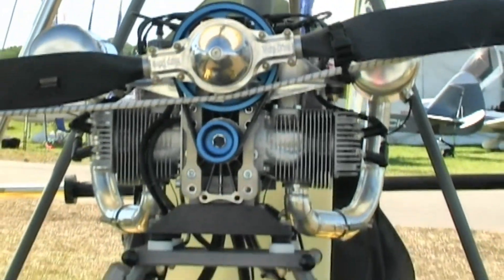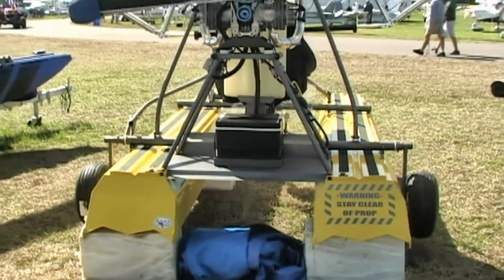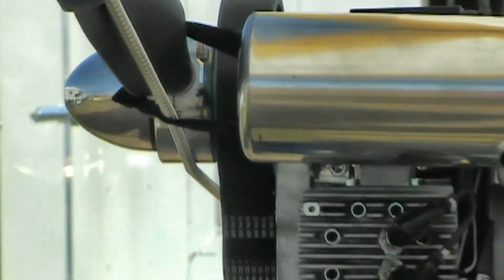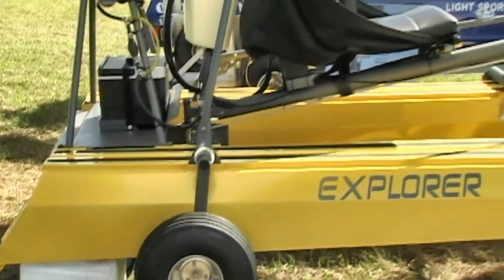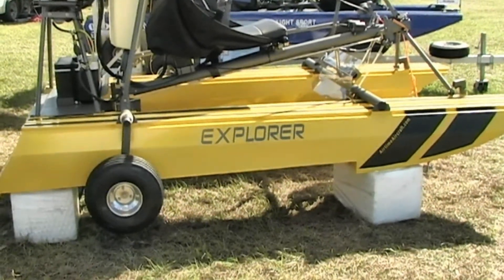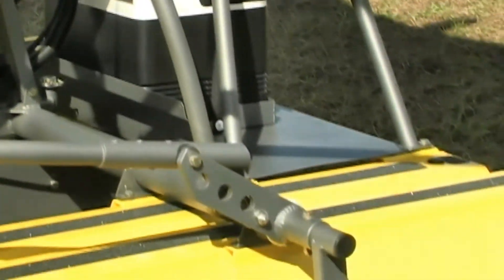This is a weight-shift aircraft — what's it like to fly a lighter aircraft? A bigger machine is going to be a little steadier on the water and in the air. It really flies very similar to our two-place. Our floats are long enough to where they track really well in the water and get up on plane easily with the step. As far as saltwater goes, the plane is made out of aluminum, stainless steel, and titanium landing gear — none of which is particularly affected by salt water.